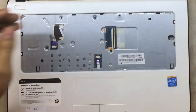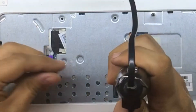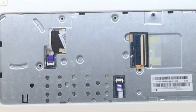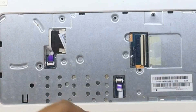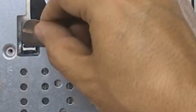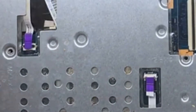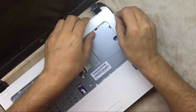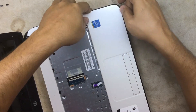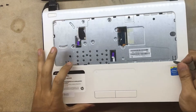There's your cable. Now you've got three screws here holding the top cover — remove those and keep them separate from the longer screws. Next, remove the touchpad, mouse keys, and the power button ribbon: just lift it and pull out the black cover. Then put your pick through the corner, lift slowly, go all around — make sure you don't scratch it.